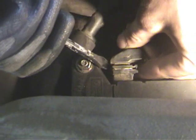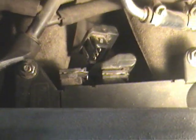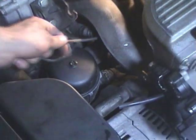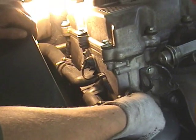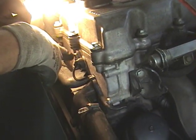This is the other side of the camshaft position sensor. You'll need to push in the metal clip there and just push it off. Pull it out from this side — it looks like there are a few attachment places for the harnesses, but first we're going to start off by removing the mounting bolt.